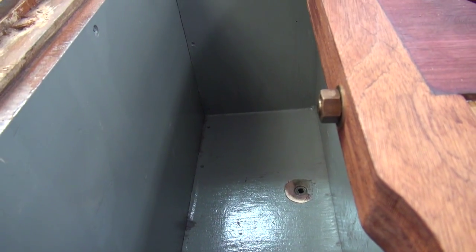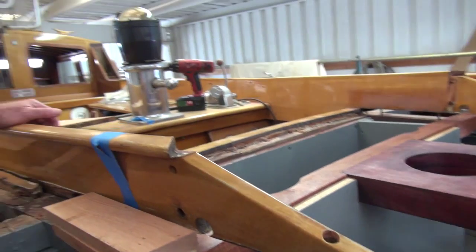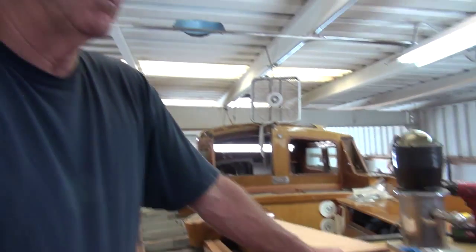Whereas now it gets sealed up nicely — we have a nice clean box. We have to change out the propane part too. In the bottom of this box where we put the tanks in, you need new tanks because they're really rusty. To avoid that in the future, we're going to put little pads about three-eighths of an inch high and then glue Irish felt onto those. What's Irish felt? Irish felt is tar-impregnated wool — the two most waterproof things on earth.